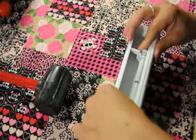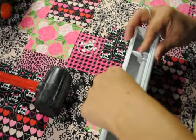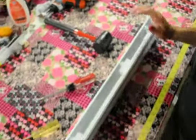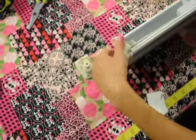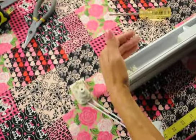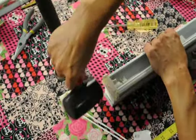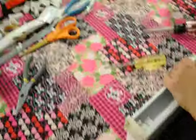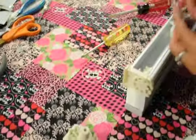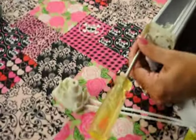You can push this with your hand until it gets to the V and then it will just slide right through. Then you're going to slide your clutch back in — if it's going in a little tight, just gently take a mallet and get it in there. And the screw that we took out, we're just going to screw that back into the same hole.